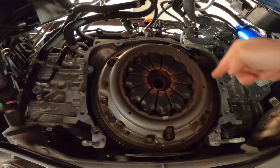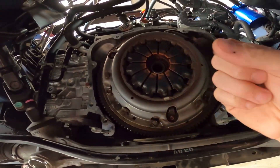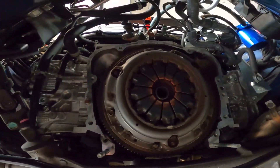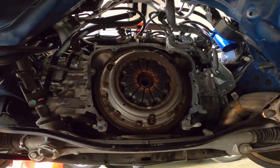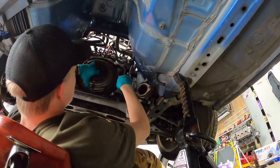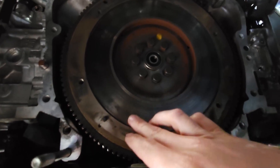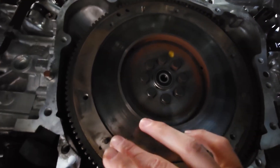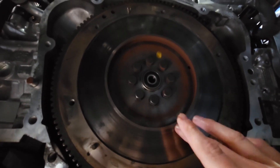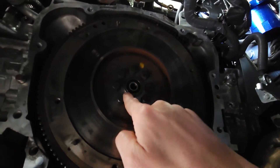There's just gonna be a few bolts all the way around the outside here — they're just a couple of 12 millimeters. You can see all this rust color here; this is all from the throw-out bearing on the transmission. I'm just gonna use the impact to blast these off. As you can see, the surface of the flywheel actually looks really good — no big hot spots, and the surface is buttery smooth. I can't feel a single lip, so I'm really happy with the condition of the flywheel. I'm going to be reusing it.